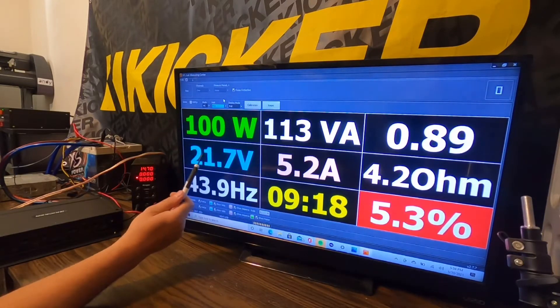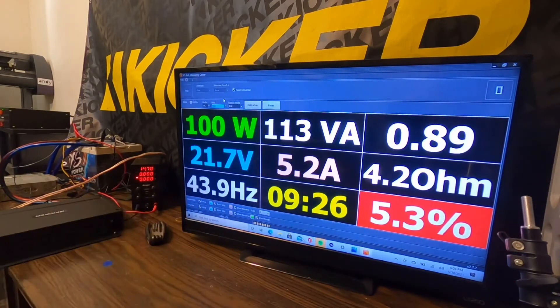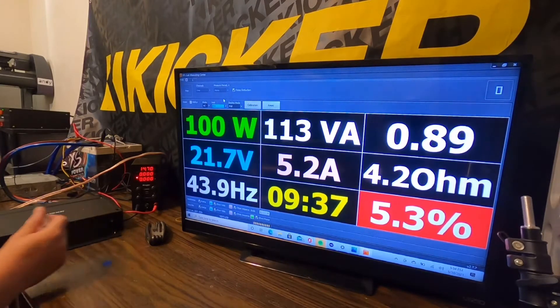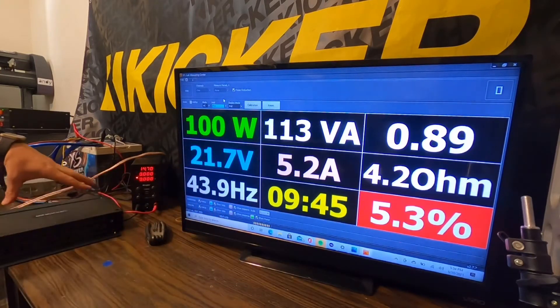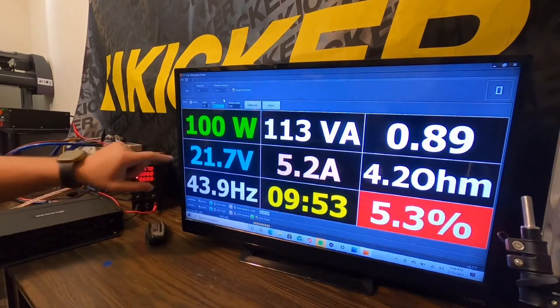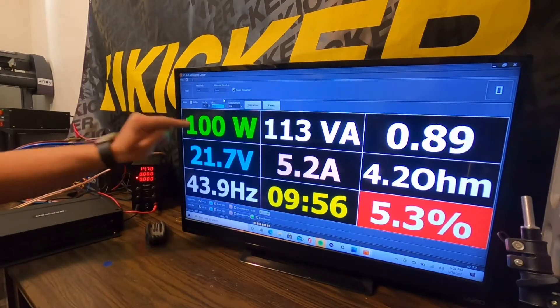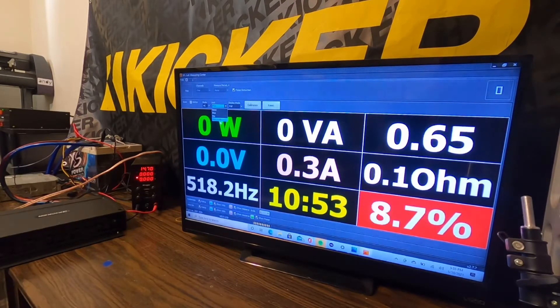Uncertified, that's literally the 2-ohm certified rating for this amplifier, so you can already see this thing's going to do rated and then some — like all Kicker amplifiers. Same story, good products. Now let's wire this at 4 ohms bridged on just two channels out of four, and see if we can get 100 watts RMS at 4 ohms. Since we're bridging two channels, the combined number needs to be 200 watts certified. The rating for this would be 200 watts RMS because we are testing two channels.